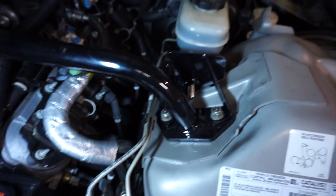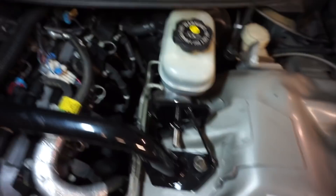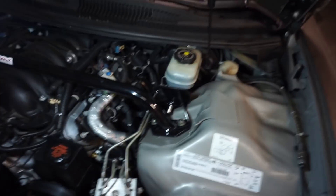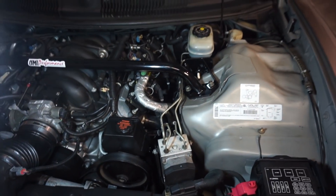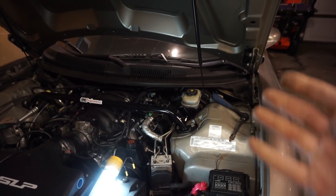A little piece of advice: when you are tightening down the front nuts on the strut tower brace, you'll tighten those to 32 pound-feet. The Torx bits in the back are going to be tightened to 37 pound-feet. You can find that on LS1tech or in the other forums — that information is pretty widely known. I'll get these torqued down to the right specification and set that preload. You don't want to put too much because you don't want to crush the thing into the power brake booster and bend your firewall. It's more just so it's secure — don't overdo it, use common sense.